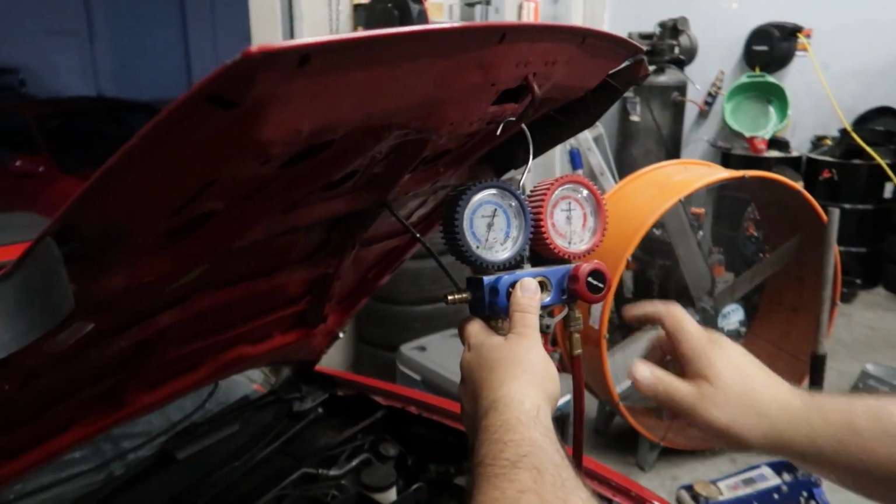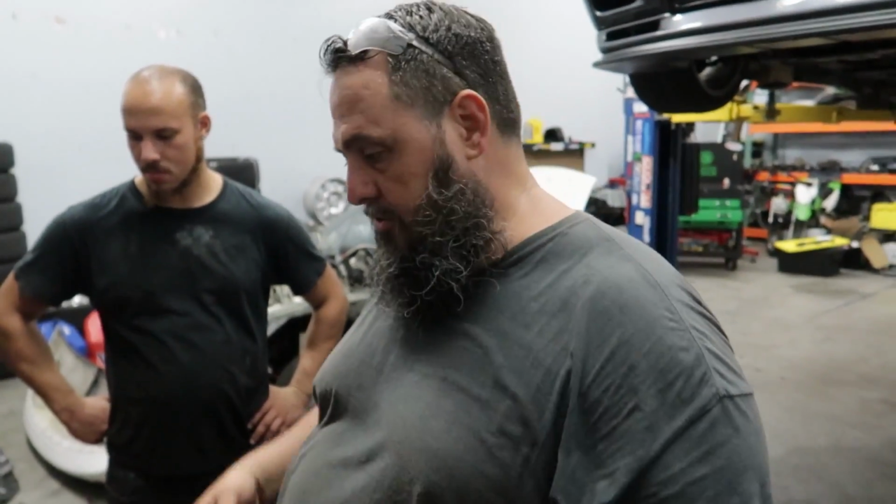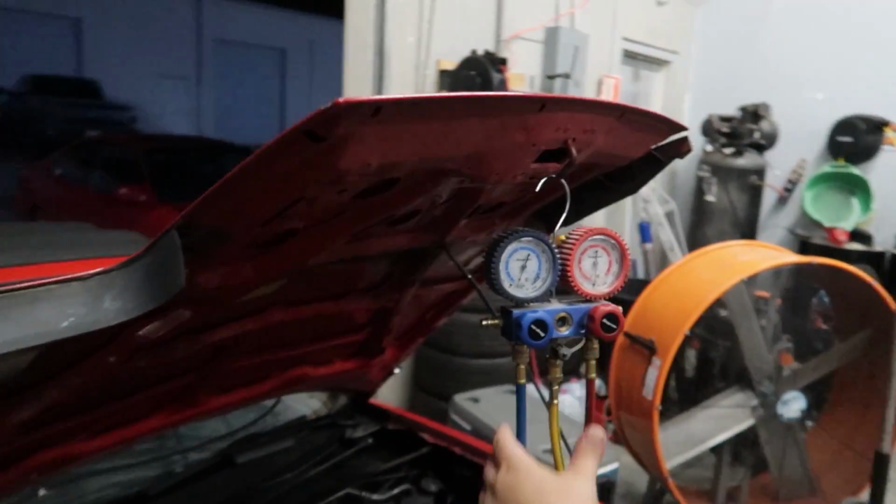Remember, one thing about ACs, most people, a condenser condenses. Air does not condense. Condensables is what you want in there. Non-condensables, you have a problem. So basically any moisture, water, or contaminants are gonna ruin your air system. Okay, so it's important that we get that all out.